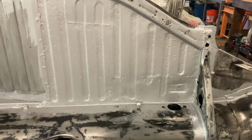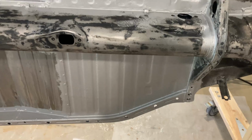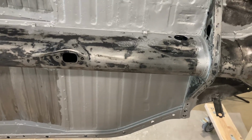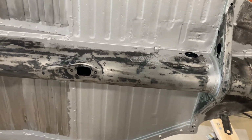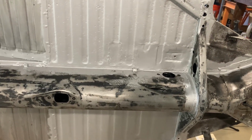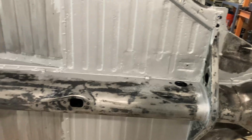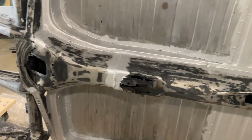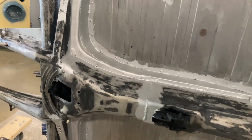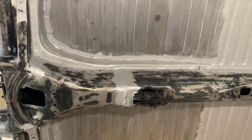These original pan sections, I did a first coat, and I'll do a second coat on. Master Series recommends 2 coats. On something this clean that's really not that rusty, and it's going to get top coated heavy anyway, I usually do 1, maybe 2 in areas that seem to need it, but it's just what works for me. You follow the directions and do what you want to do to get it done the right way. So that's where I'm at.